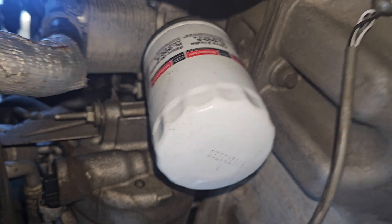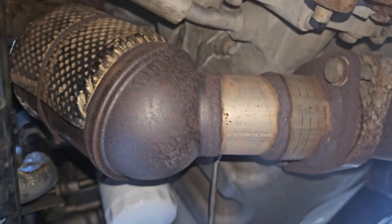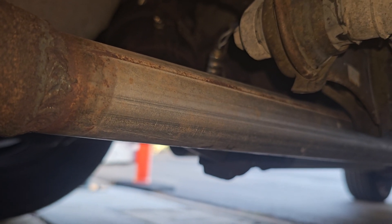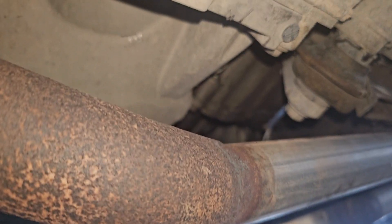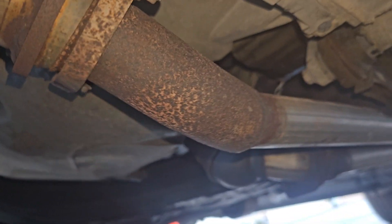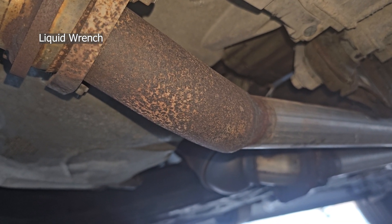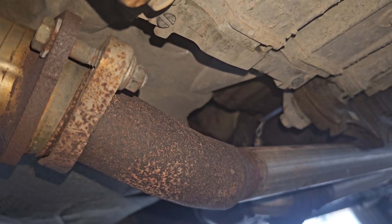For the lower one, here it is — you can use the oil filter as your guide. Here is the front cat on the 3.5 EcoBoost, and behind it is the second cat. You can see there is a downstream oxygen sensor on both of them — downstream means the second one if you didn't know. You just have to jack the car up a little to reach those. It's also recommended to spray some penetrating oil or liquid wrench on them first to loosen things up.